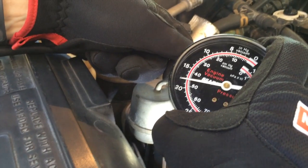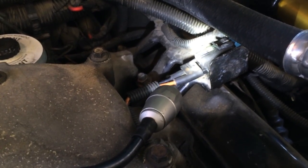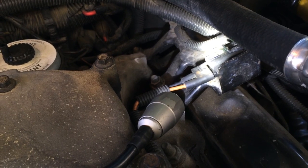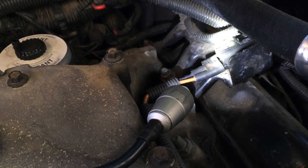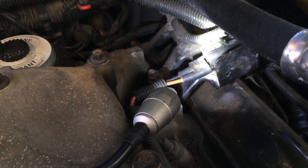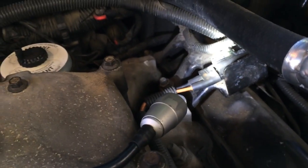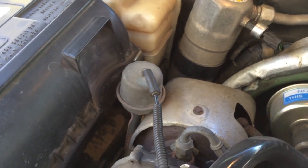Engine is shut off now, so we can recap. We're focused on the wastegate solenoid here. The factory vacuum hose is a hard line hose — I'd recommend you replace it with the same thing on a diesel engine, because soft rubber hoses are much more likely to be damaged from the heat. The vacuum pressure you want on both ends is 15 inches of mercury minimum. You need that vacuum gauge from Sears or Harbor Freight. Check the vacuum pump, primary line, and wastegate solenoid if you're not getting expected vacuum at the actuator.